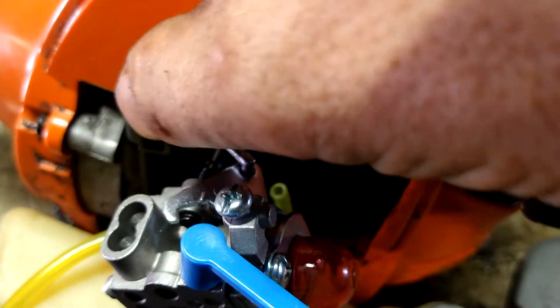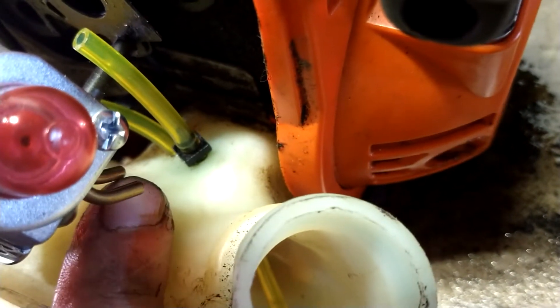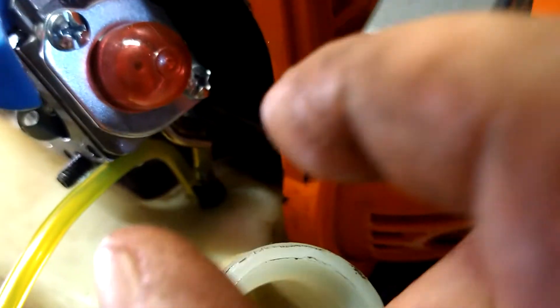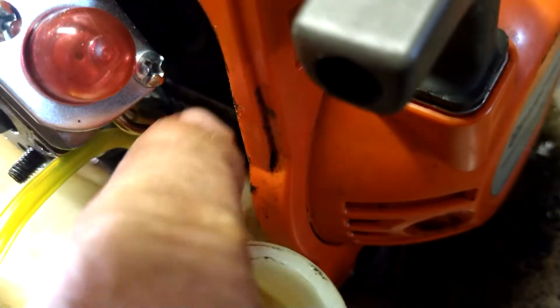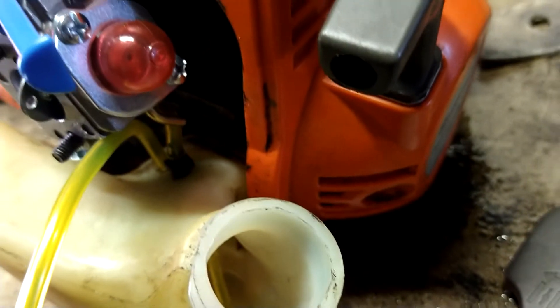Cable in, this block sits right up on here. Make sure the cable is on the other side of that nipple. This fuel line that goes to the filter goes to the back nipple. It may be a little bit long, but you'll be able to grab it on the bottom and pull it until it gets to the right length. This one I had to cut to size. Then get the other line, cut it to size, put it on there — you can always pull it from the bottom to shorten it up after you get it on.